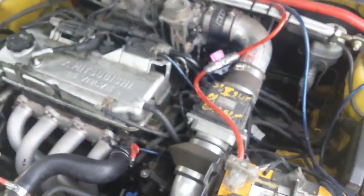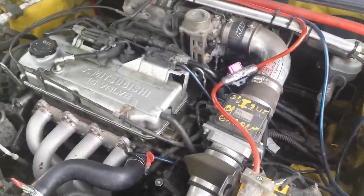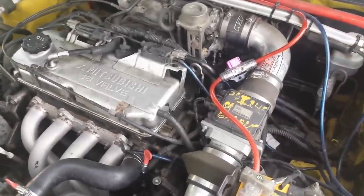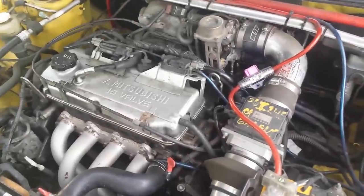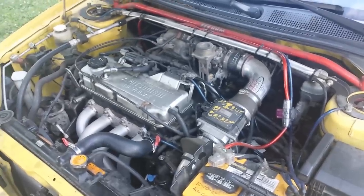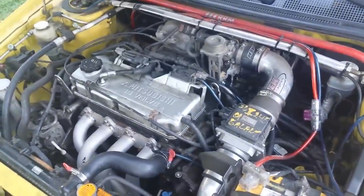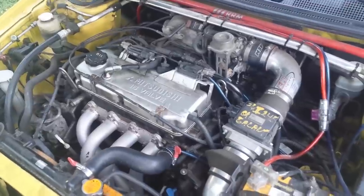Reconnect the battery. Your car runs through a startup cycle, so it'll take a little while to relearn the fuel curve and all that. It may run a little rough at the beginning, but after a couple hundred miles it should be worked out. That's all there is to it — and there she is purring away. Your idling issues should be helped out a lot by this EGR fix, and you should be good to hit the road.